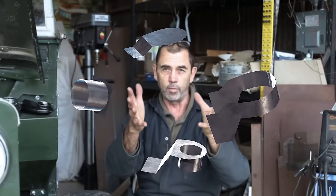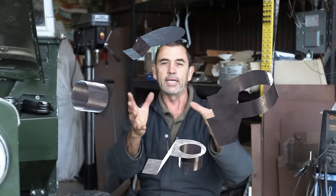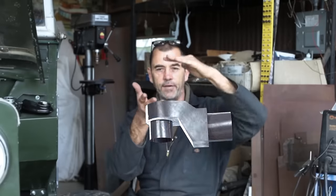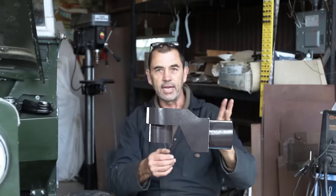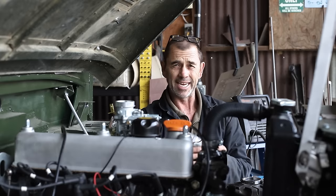Okay, so we've got four pieces and the pipes are welded into the sheet metal. So what we're doing here is we attach them. And as you can see, it's going to lock on to our carburetor, but then it's a very low profile that then jogs down so that it goes beneath the bonnet support beam and then connects to our outgoing pipe to an airbox.